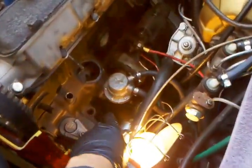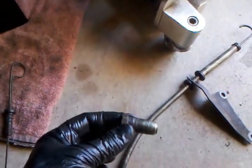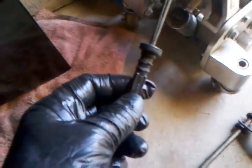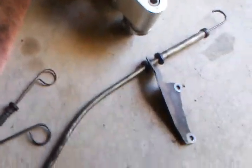Our other challenge is the dipstick. Here's the hole where the screw-in dipstick went. Here's the screw-in dipstick that was originally on the car along with its bracket — that's the big piece that screws into the block that the dipstick tube fits into. What we found is that the hole in the block is too big to accommodate one of the shorter early car dipsticks, yet the fitting size is too small for that dipstick to fit. So we're either going to modify this piece to be shorter or try and trim one of these dipstick seals and seal it in this mounting hardware.